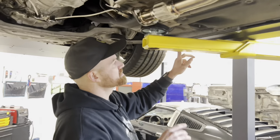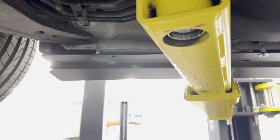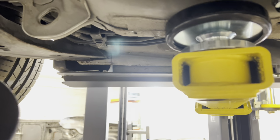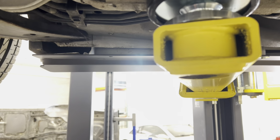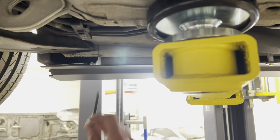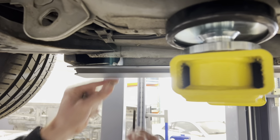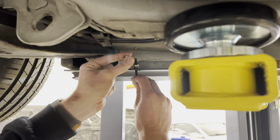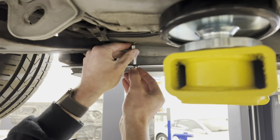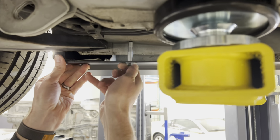Next thing I'm going to do is come forward, and this front hole right here, where I've already drilled and installed that M6 riv nut, I'm going to go ahead and get that, which we talked about in our hardware kit, was that M6 by 70 with the Allen head. I'm going to put a washer on it, and then in this spot, what we found worked pretty well was 4 of the aluminum spacers. So, you know, 1, 2, 3, 4. Go ahead and get that lined up, started by hand.